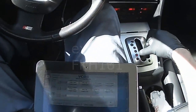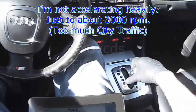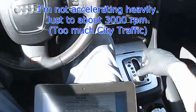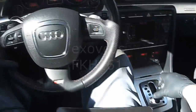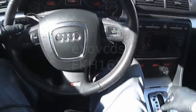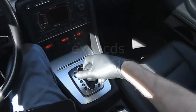Accelerate again here. Specified 1800, I'm at 1300, 1400. It's definitely a delay here. Boost does build, but it's not enough. Specified 1800, I'm at 1300 — so boost is leaking somewhere. I can't hear it outside of the vehicle, so it's probably not a broken hose.